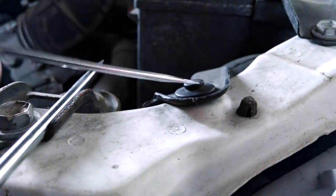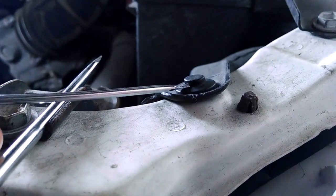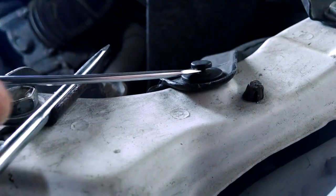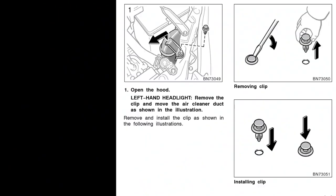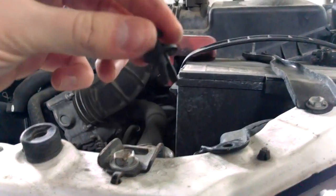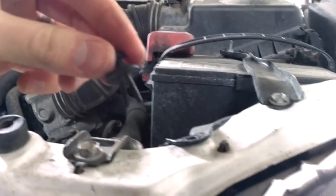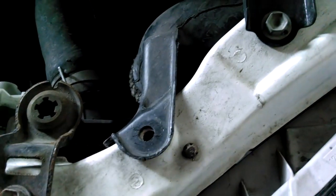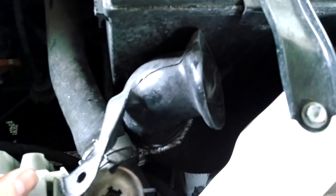To pull the screw out, get a screwdriver underneath it. I actually like using two screwdrivers so you can come from both sides and not feel like you're yanking it too much. Pull it out — it's got two ends on it. Set it aside; we'll need it again in a minute. Now the air filter is connected to a hose on the bottom so you can't pull it very far, but just pull it to the side to get better access.